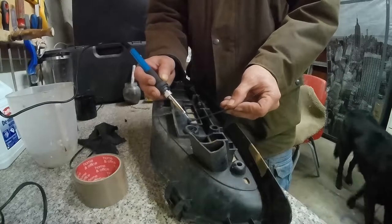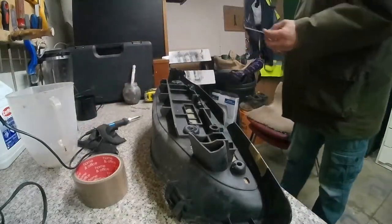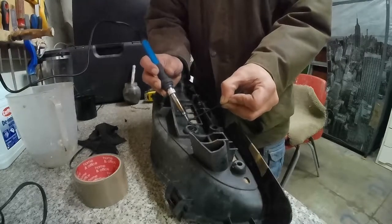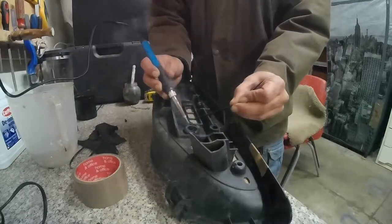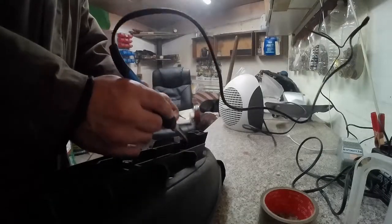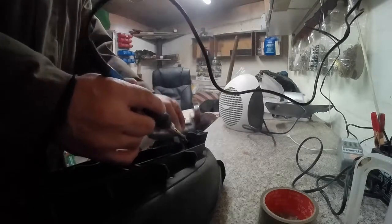Here you'll see I'm basically using the cable tie and the solder iron with a chisel flat tip, melting the cable tie in little droplets along the crack — it's quite a big crack along the footwell. I'm putting little drops down to hold it into place, then I'll make a line of weld with the plastic cable tie that will mold together the broken location to a good solid position.